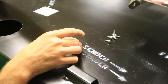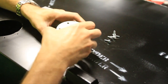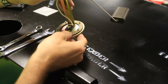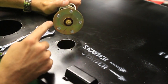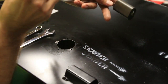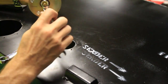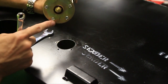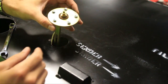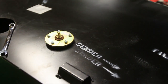Then we're going to put the gasket in place and put it through — make sure it's pointed the right direction. I put the gasket on and pushed the screws through, but this is where it gets a little confusing. Those aren't perfectly centered around there, so there's only one way this can go in. It just so happens it goes in this way and the sender needs to be facing this way. So I'm going to unscrew this and turn that around. I've made a mark here — that mark is supposed to line up with that mark — but I need to turn the float around. Looks like I just needed to rotate the sender around 180 degrees, then I tighten the nut back down.